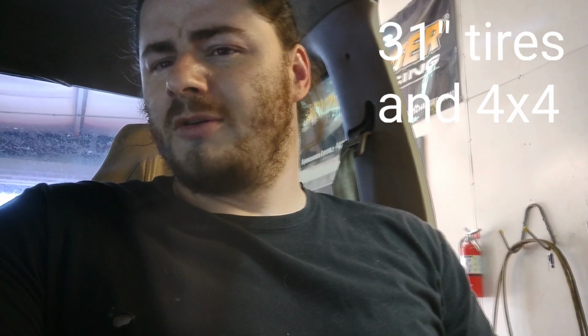But I've had some people talking about the throttle bodies, and I sell ported 50mm stock bore throttle bodies, and everyone's like, oh, you need bigger. And I don't think so. So I've got the 50 on here now. We've done timing sweeps. It's only making about 240 horse and 300 foot-pounds. I'll go over those dyno graphs here in a second.